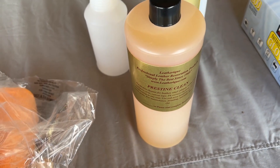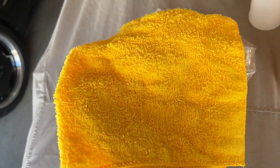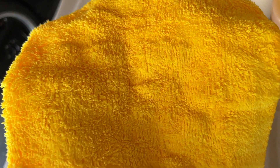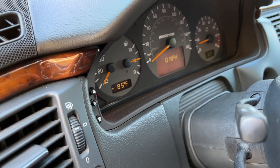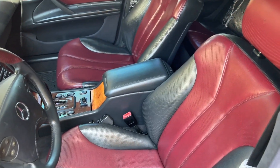Now I'll go ahead and clean it off with the Pristine Clean. I poured it into the spray bottle and I'm using a damp microfiber towel — spraying the Pristine Clean directly on the leather and onto the towel, wiping it off, then going back with another damp towel and a dry cloth. One important note: the temperature reading inside the garage was also 85 degrees, which was actually really optimal for this Leatherique application. On the driver's side of the rear seat, those white marks are just dirt — spray some Pristine Clean and lightly agitate with your fingers.